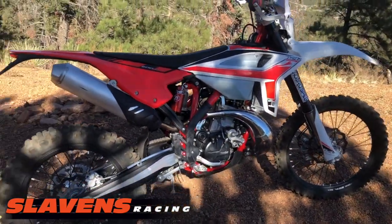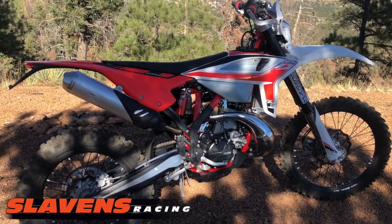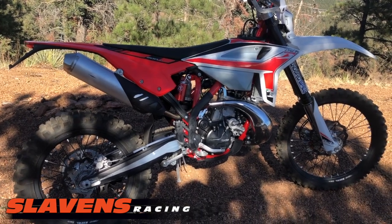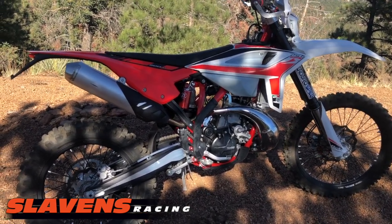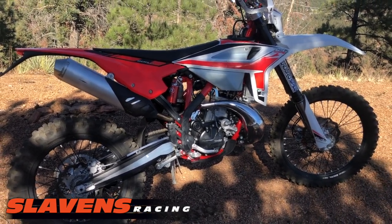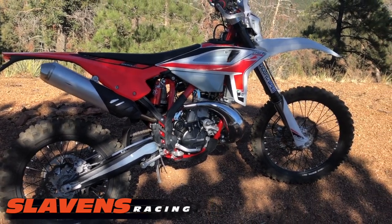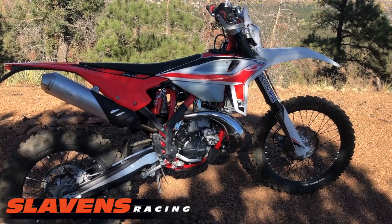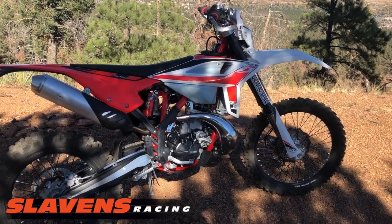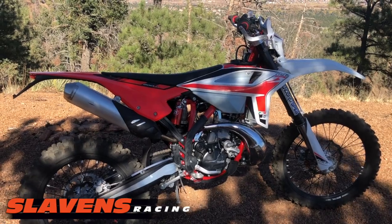It's not enough engine for me at this elevation. You know, I'm a big guy. I prefer the 300s, but these little 200 Buzz Bombs are nice little bikes. Good bottom end, really low first gear. I think I'm going to probably gear it up just a little bit. First gear is almost useless, it's so low. And I think the bike would accelerate a lot better with maybe a little bit taller gearing. So stay tuned guys for stage 2. Going to work on the head. Should be stage 2, could change, but anyhow, stay tuned.